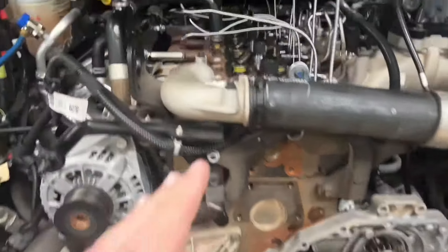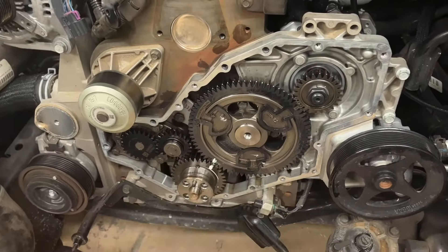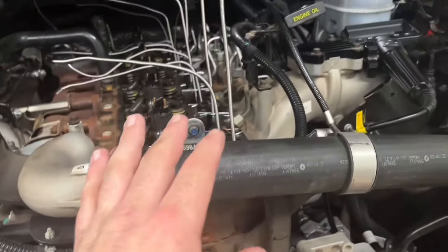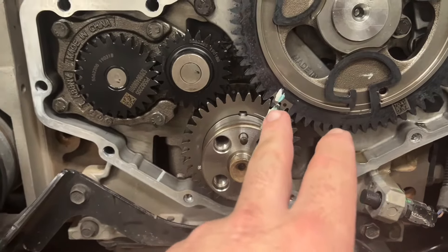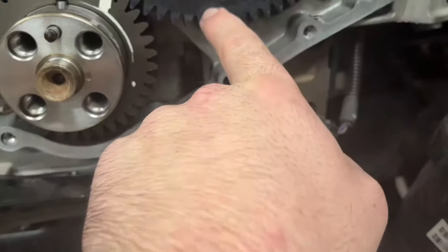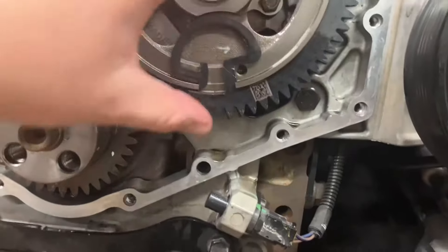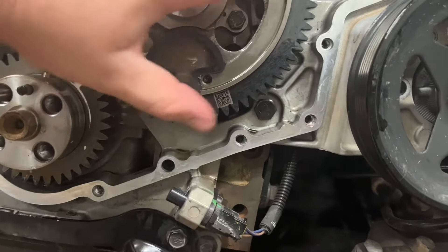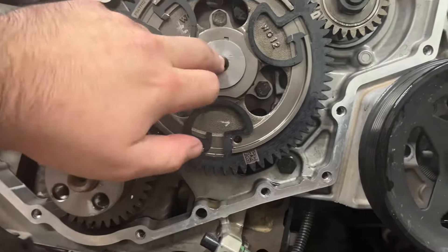The camshaft is now in. There was some difficulty — once the gear was there you have no leverage, and the cam is very heavy since this is a solid cam. Wiggling it in is difficult because being too violent could disturb one of the lifters and drop it down, which is why strong magnets are important for the install. This cam has a scissor gear, which is a bit different than earlier trucks. I lined it up against the scissor, held a flathead screwdriver wedged in the notch, pushed and tapped it with a hammer so it wouldn't bounce back, and eventually it popped in. Then I tapped it lightly with the wooden hammer grip to seat it and tightened down the retainer.